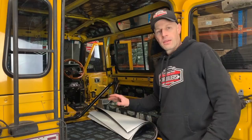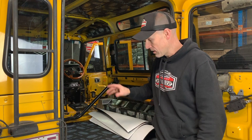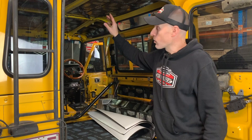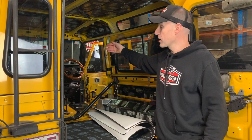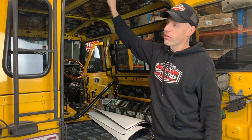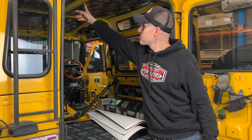So now that we've got all our Stage 1 sound deadener installed, we've got our 6mm insulator, which is a peel-and-stick closed-cell foam. This is designed to stick directly to the roof skin. I've got three sheets here which are going to cover the roof skin, and we'll potentially have some excess down that B-pillar where your ear sits right next to. So we're going to measure those rectangles, pre-cut our sheets, bring them in, and stick them on. We're going to butt up to all these top-hat sections. We haven't put dampening sheets on these top-hat sections because - picture this like a drum skin - in the open areas is where the dampening issue is. On this top-hat section, it's got that much strength in the fold that you're not going to get any panel resonance. We're not going to go over that too because of packaging - the headliner clips onto hard datums here, so if we put anything under it, the trimmer is not going to fit.